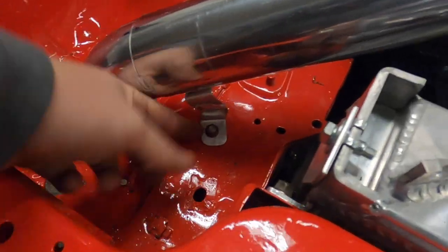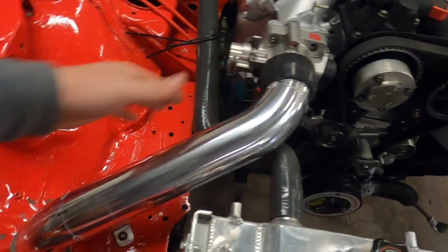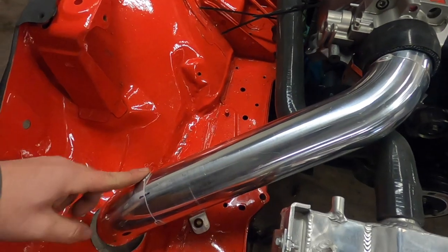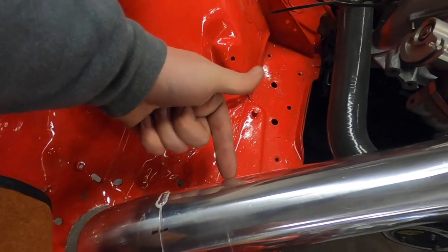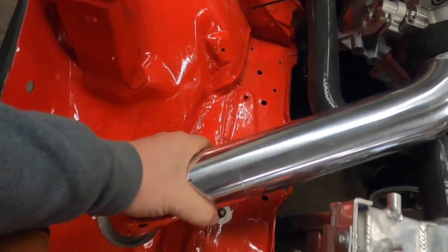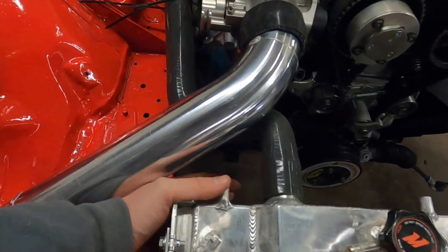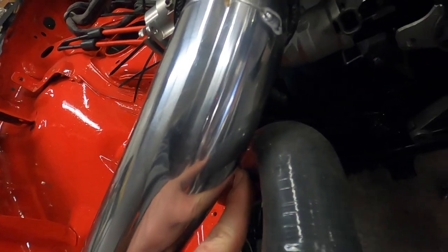I whipped up a bracket down here to hold it all in place — just held with one bolt — and once there's a clamp up on here, this thing is going to be rigid, but it can still move enough as the engine moves. The next thing I'm going to do is full-weld both seams — I think there's only two. Then I'm going to drill and put the IAT sensor right here; super easy to get to. If we ever have to swap it out, just pop it out and pop a new one in. It's out of the radiator heat path, so this should work really well. And it'll clear the second small fan that's going right underneath — there's a little gap there.